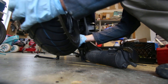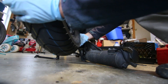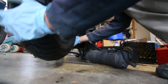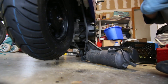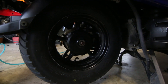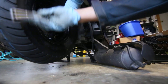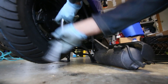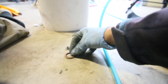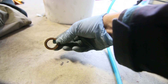There we go — the tire is on the bike. You need the washer and then the nut on here. To put the exhaust back, we're going to need these two nuts and then there's a washer that holds the header into the exhaust. Make sure you don't forget this stuff.